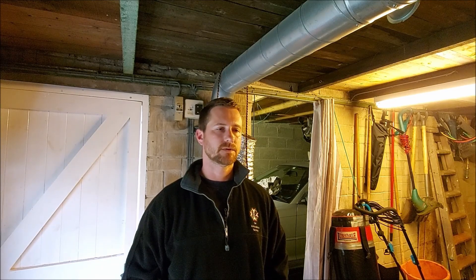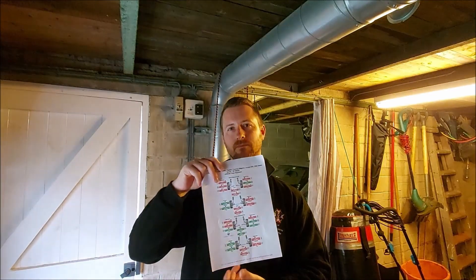Hi YouTube, so this is going to be a BMW video. Today's tasks are going to take a lot longer than one day. The overall plan is to drop the ride height a bit. I also went for an alignment because the front toe was completely out, so I've got these stats that provide all the different angles like toe, camber, and caster.